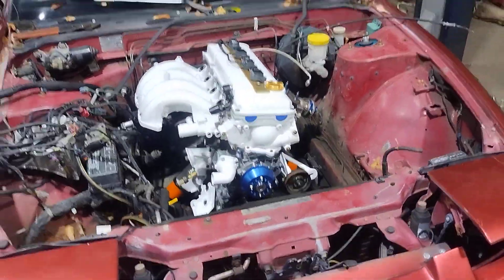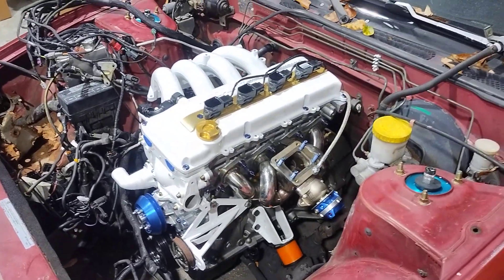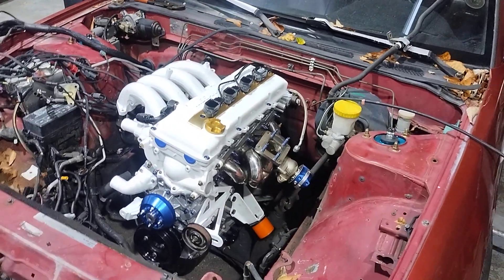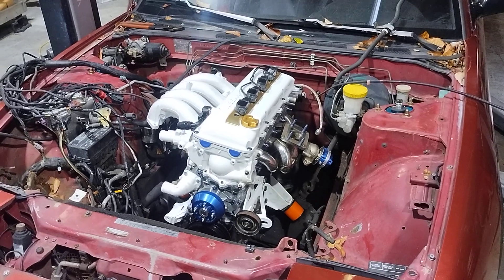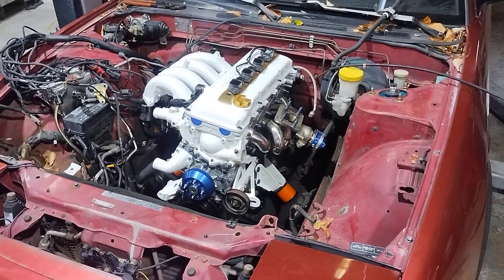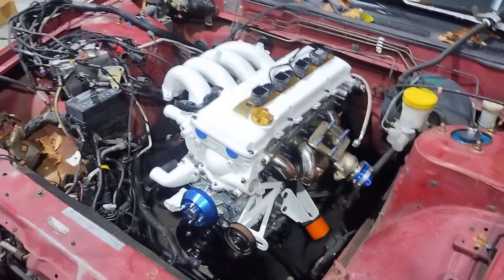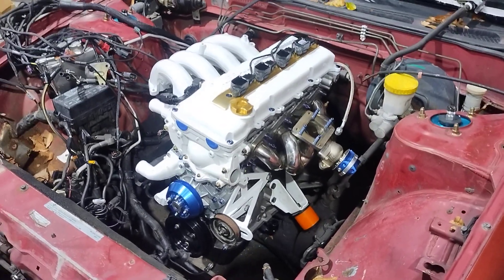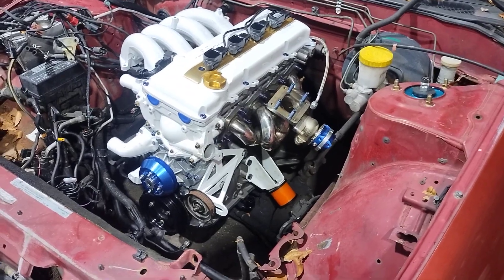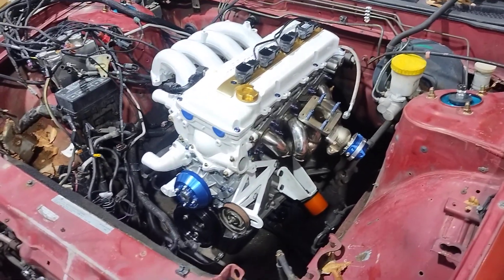This is my first video ever on this channel, so if you want to check out this project please subscribe. I actually never mentioned the engine specs — it's a 90mm bore with Wiseco 9-to-1 pistons and Eagle rods, with a micro-polished crank and ACL rod and main bearings. The head is kind of a mystery — I got it from a machine shop that used to build a lot of 240 heads for one of the drift teams around here, and neither they nor I know exactly what's in it. I got a pretty good deal on it, and it's been fully prepped.